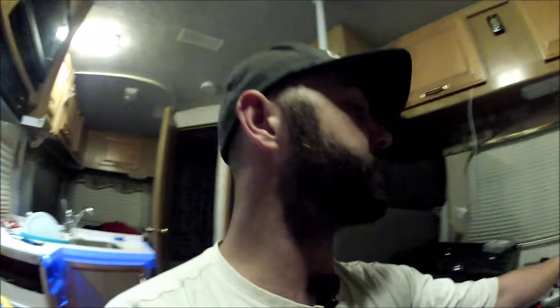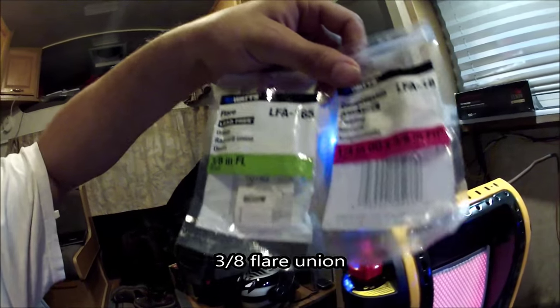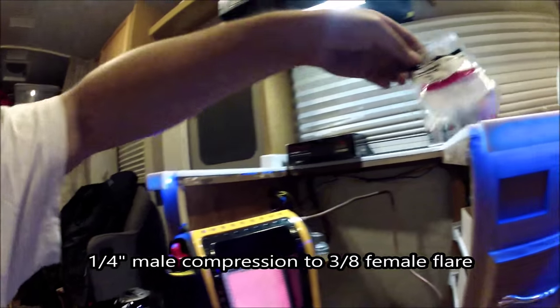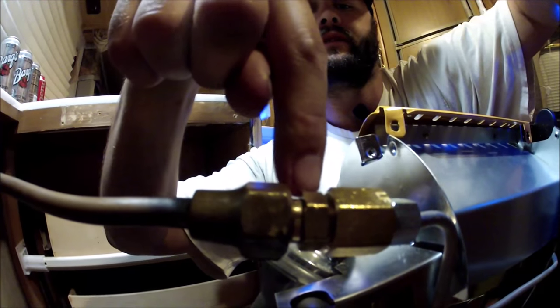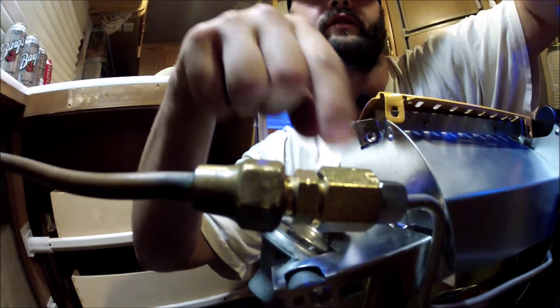The way I did that was with these two different fittings that I got — you can get them from Home Depot or Lowe's. One's a flared union, flare-to-flare on each side, three-eighths, and that's just to connect to my system on the RV. Then I also have a quarter-inch compression coupling to a three-eighths female thread. I'm going to turn this thing off because it is warm in here, but I basically bypassed the factory regulator — you can see that right there — and I have the flare-to-flare right in the middle. It's a male flare-to-male flare, and then the female flare to the quarter-inch compression is right there.